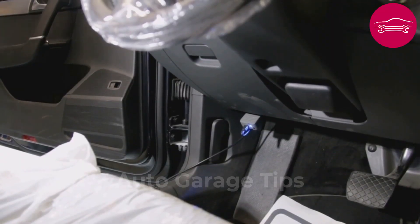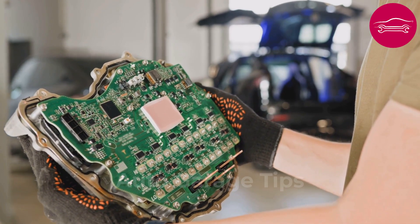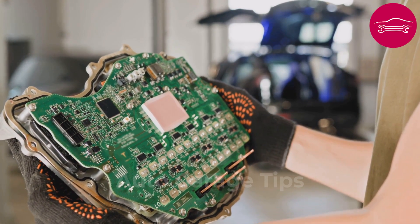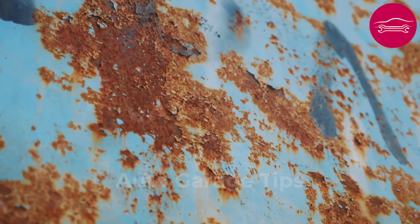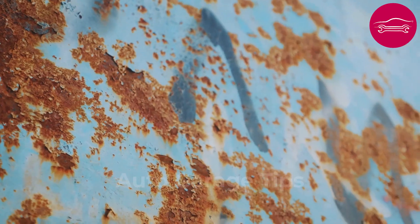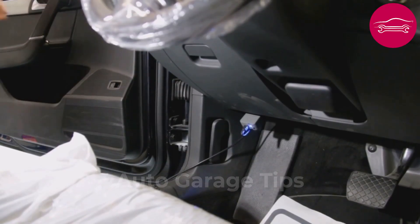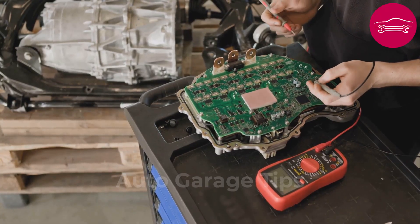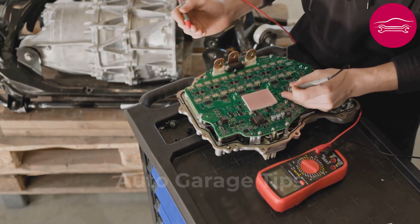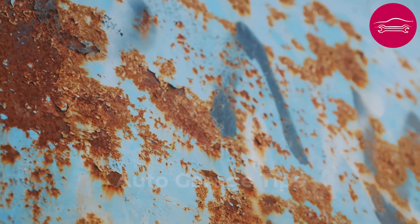Number 2: Inspect and thoroughly clean the main engine computer connector. The computer represents your vehicle's electronic brain and its connector suffers numerous stresses — vibrations, humidity, and corrosion can disturb connections and generate intermittent failures. Locate the computer box, usually installed under the dashboard or in the engine compartment. Carefully disconnect the main connector by unlocking safety clips with caution. Carefully examine metal pins, which must show no trace of verdigris or oxidation.